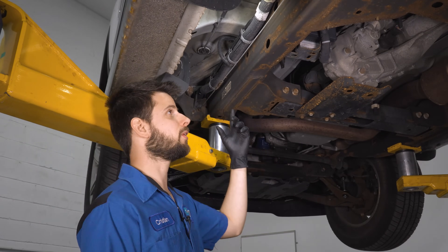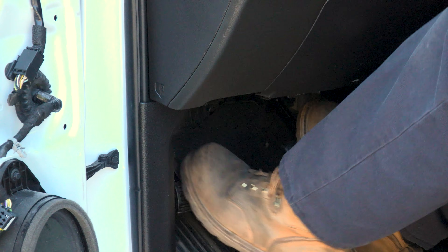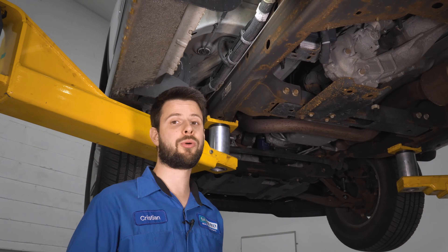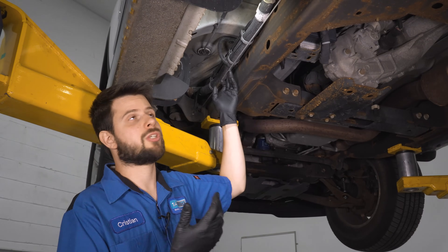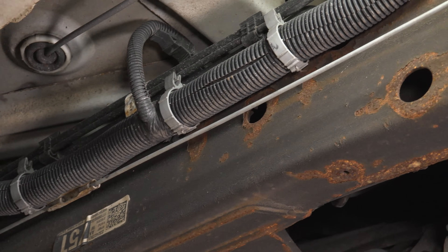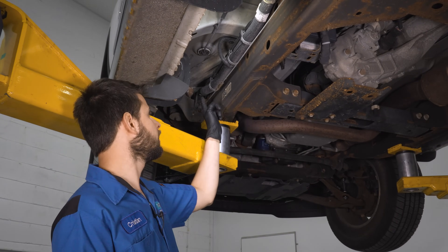This being a truck, we can see all the cables underneath. That one up there connects everything to the pedal assembly, which we indirectly tested earlier. When I was applying and disengaging the parking brake, everything seemed to work fine — the pedal went down smoothly with the right amount of resistance and came back up without floating or getting stuck. So that checks out, and therefore this cable does as well. The center cable connected to it can't really get stuck here since it's just out in the open, not going through any sheathing or brackets. It looks great.